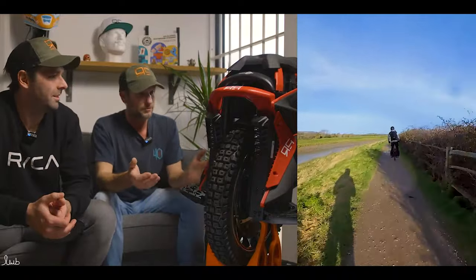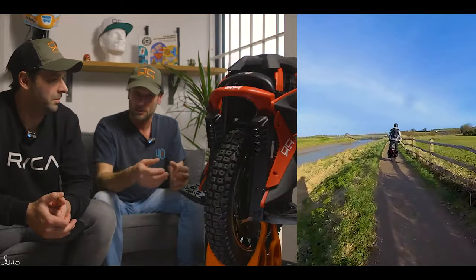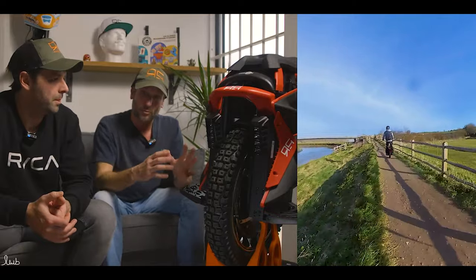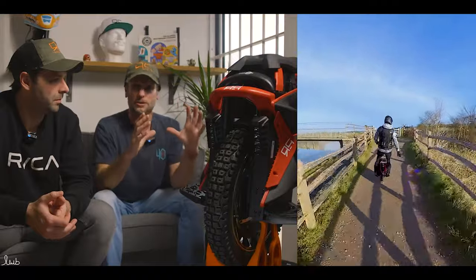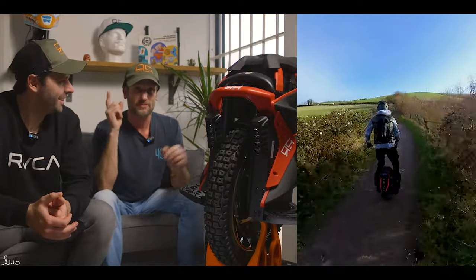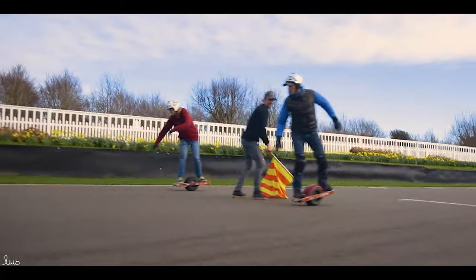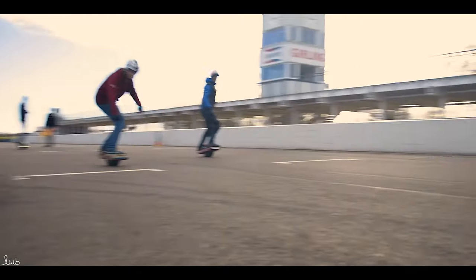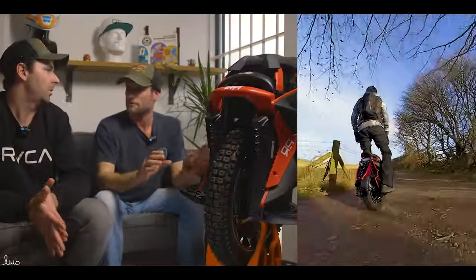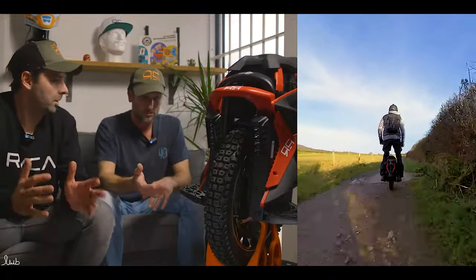You've got a really large wheel, so it's got a real fast rolling speed. A small wheel is really twitchy, really unstable, really dynamic, but a small wheel inherently has its torque because it's got a small rolling radius. A big wheel is not going to have the fast initial acceleration like a small wheel — like the point where a smaller wheel beats a bigger one in acceleration before the bigger wheel takes over. By design, this wheel is inherently going to be fast over general off-road terrain because of the size, but totally controllable.